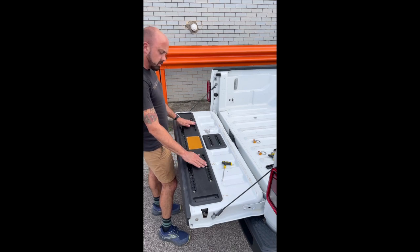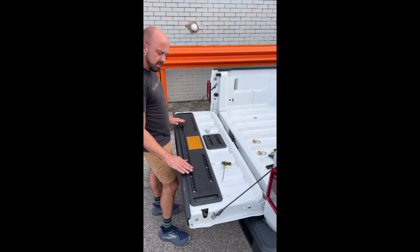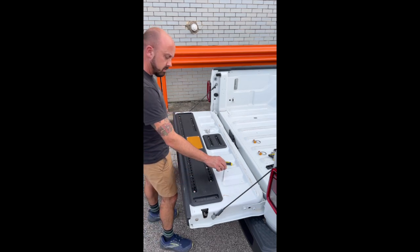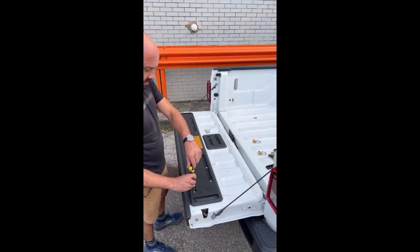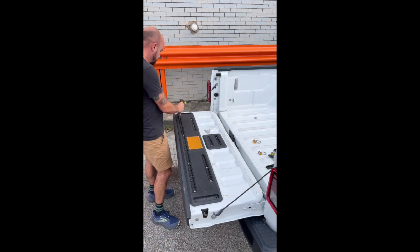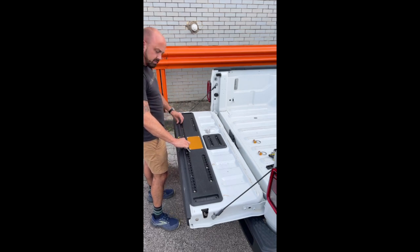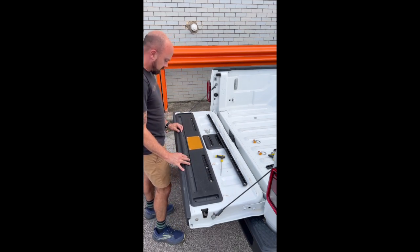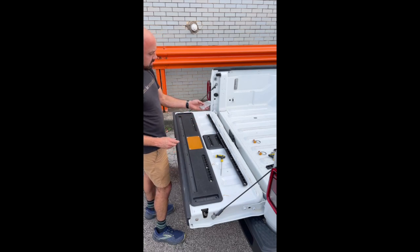We've shipped these L-tracks already installed, but we need to remove, believe it or not, this 41-inch piece because we mount the BaseGate to the Jeep underneath this L-track. We've only secured it with these two outer M6x10 stainless steel screws. So we're simply going to unscrew this like this, and lift out our 41-inch piece, which reveals two countersunk M6x30 screws here, which are included in this 8-pack.